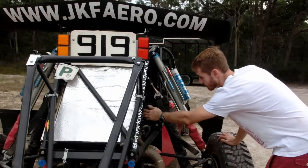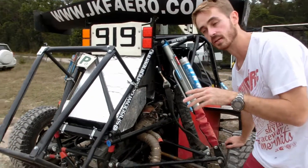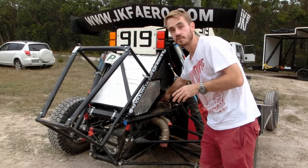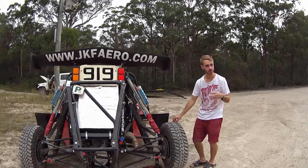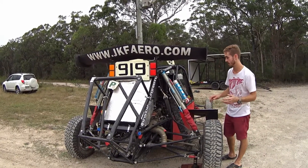As we move around, we've got the turbo on this side. The engine out of this is a WRX STI engine — a two-litre engine from the Australian 2002 model STI, fully reconditioned top-end, and then also a VF34 turbo on the back of it. Not an extremely powerful turbo, but it gives you a decent mid-range and will provide enough top-end power for the sort of driving that we're doing.